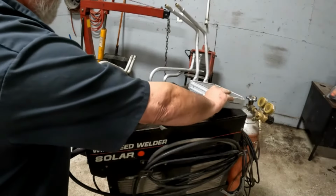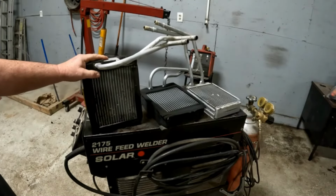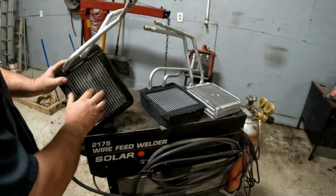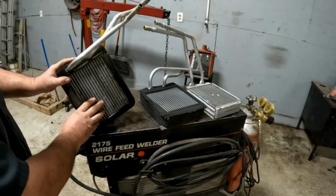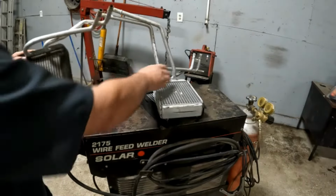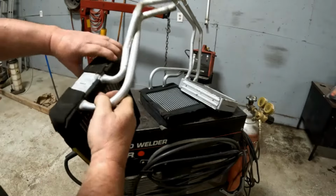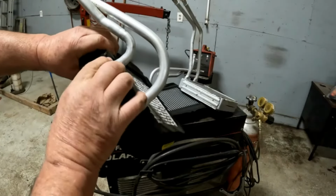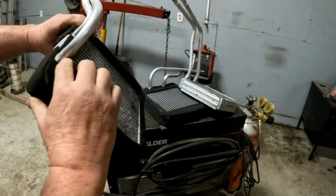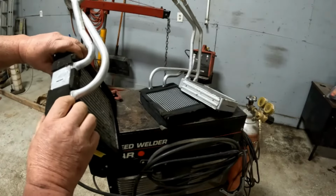The other thing that I've noticed, they started making these heater cores like a universal type deal, where they would only have one size core, but they could put any tubes they want, any bends on the tubes, and they could crimp them into these universal cores. When they do it, they put a crimp right here where these tubes go into the core itself. I guess they put a seal in there. Well, I've seen them go to leak on them seals. So I want to try to avoid them at all costs.